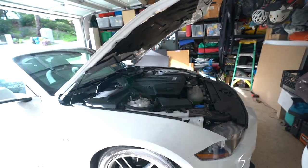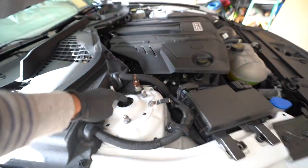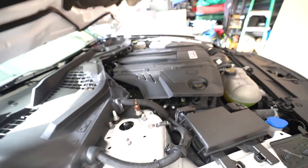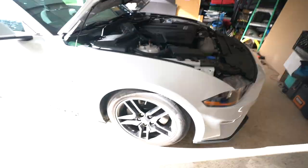We're lifting up the car and tightening the bolts properly now. I'm going to check the strut mount bolts — I know the strut tower bolts are tight but I want to verify as much as I can. I didn't notice any clunking in the front, mostly in the rear, but I'm going to do a general bolt check on everything we touched yesterday.